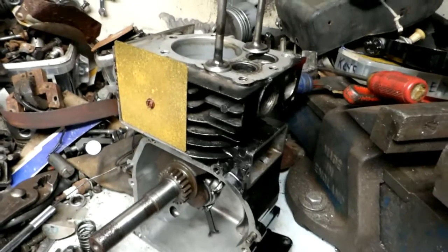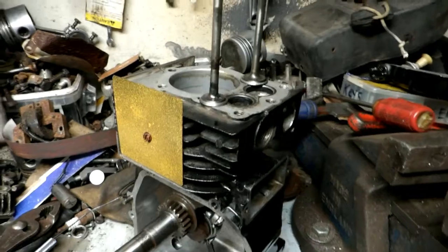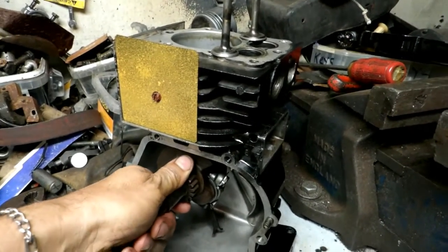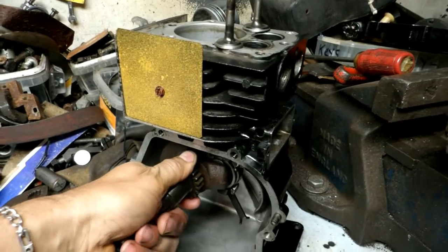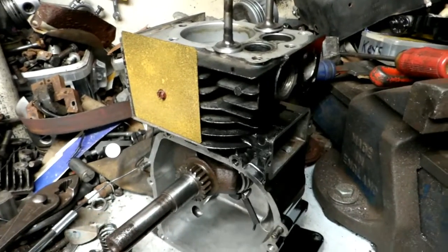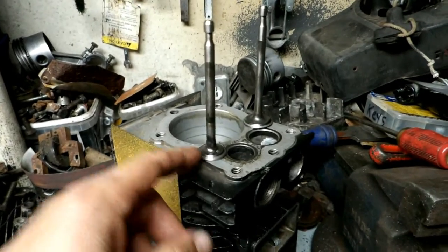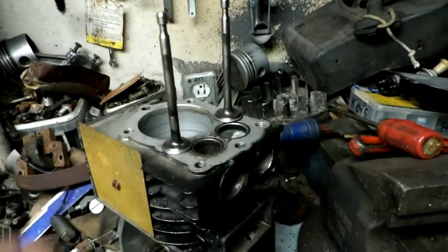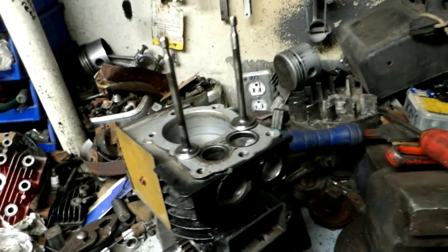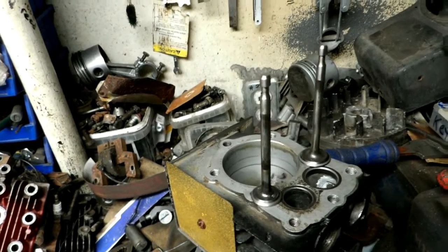So I'm just building up another engine for the H12. This one's kind of bits and pieces — I've got the piston and block from one engine and the crank from another. It was an old one sitting on my floor, like a ball of rust, so I spent a lot of time sanding on it and got all the journals right. I've lapped the valves and did a little minor port job on the intake and exhaust, getting rid of the aluminum fins in them that don't help flow.